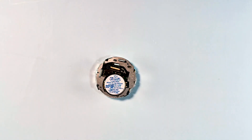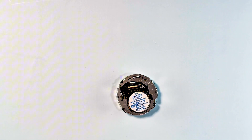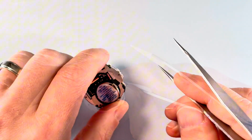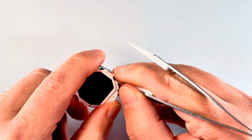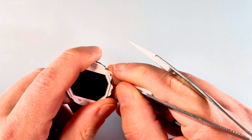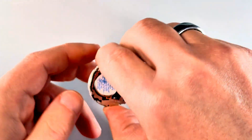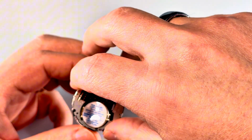Before we start, we want to release the battery — I'm going to need some kind of tweezers with a point. Just release the battery like so, then release all six clips, and just be careful the whole module doesn't blow open. Turn it upside down and gently lift the metal case away.